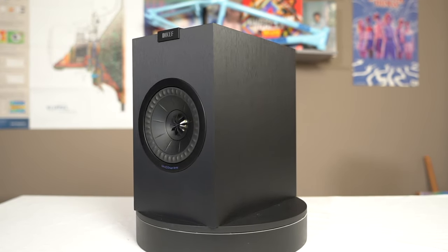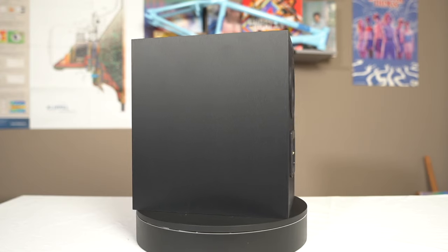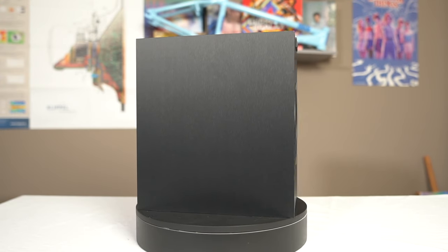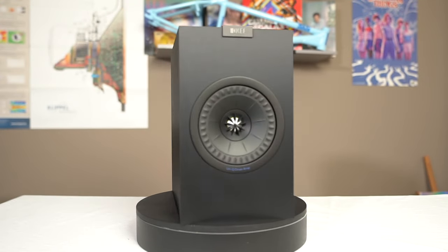This is a two-way design featuring a single coaxial concentric drive unit. It comes in ported or sealed configuration, with a one-inch dome tweeter and a five-and-a-quarter-inch mid-range that operate in tandem as a coaxial design. My listening was done upstairs in my home theater room with acoustic paneling throughout, so it may differ from your room — there's a slight uptick in high frequency response, which can sound a bit treble heavy. When I brought it downstairs with no room treatment I did find it to be a little brighter than I'd personally care for.